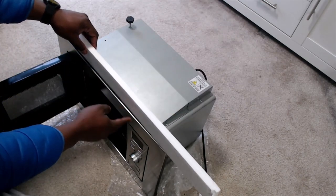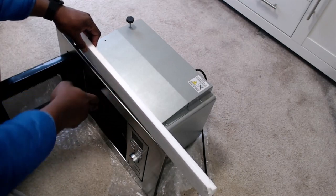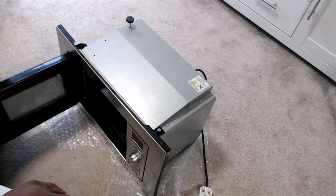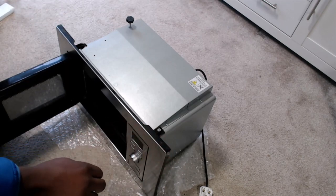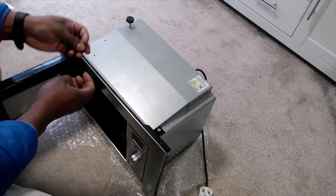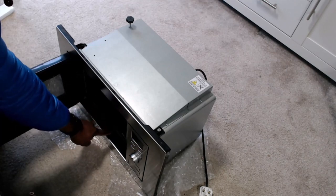This way it locks the microwave in place from tilting forward. Once the entire microwave has been fitted into the slot it will become flush against the panel so the entire thing is sealed. This is because of the slope and shape of the microwave. Once you've got the microwave fully into the slot you would again replace your Phillips head screw and place your cap on top of the screw hole.